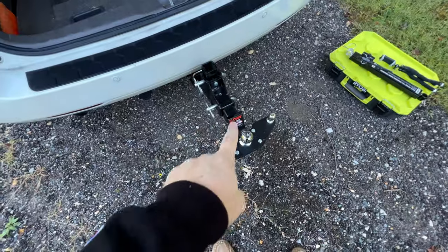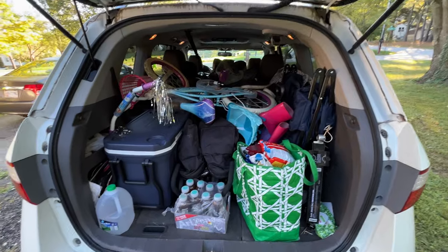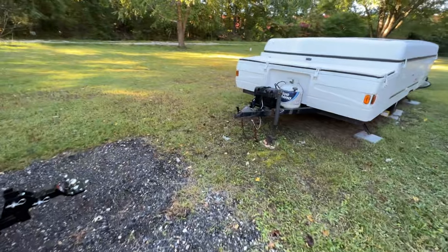Quick update: I've got the hitch in place and that's ready to go. We're going to be loading up the van in just a few minutes. We won't be putting on the sway bar until we get on the highway — from what we've read and researched, you shouldn't put it on in neighborhoods because of all the turns. You really want to use it on straightaways and coming off exits. I might have to adjust the tension a little bit, but we'll wait until we at least get on the highway.